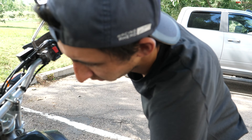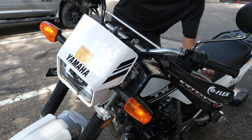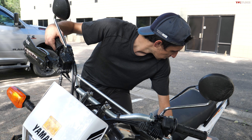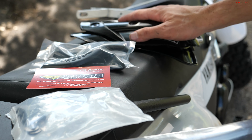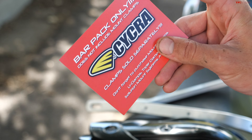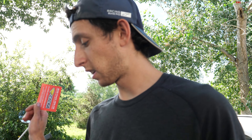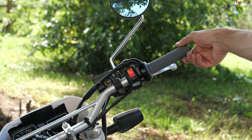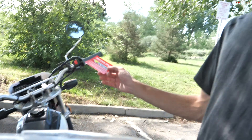She's cold-blooded. So we just got everything done besides the handguards — I didn't read the instructions carefully enough and it turns out the mount clamps that go on the bar are sold separately. So we're going to have to order those and put the handguards on later. Not a big deal. The bike is still road worthy — we have a new chain, oil, fresh filter, and new grips. We also found out that our throttle tube was a little bit cracked. The throttle's not sticking so I feel comfortable riding it, but throttle tubes are cheap, so when we place another order for the bar clamps we'll grab one then. Other than that, this bike is ready to go out on the trail.